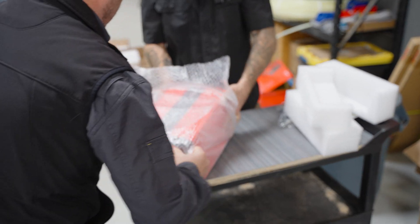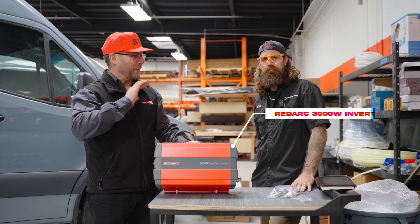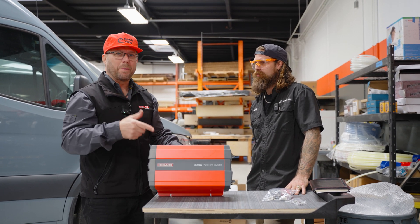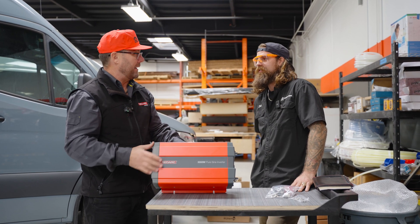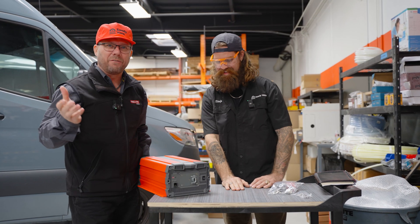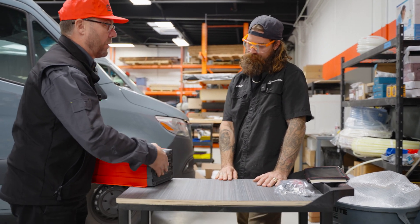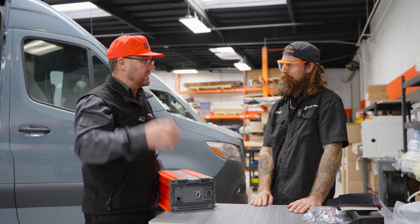This thing is massive. The 3000-watt inverter is going to run your coffee machines, your hair dryer, or your curling wand — whatever you're going to throw at it. Unlike other inverters you might see in the US, this one's actually going to be hardwired, so there are no power points on the front of it. You will need to hardwire it into your system.